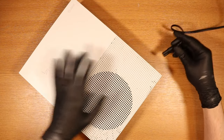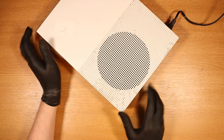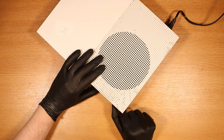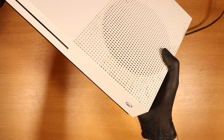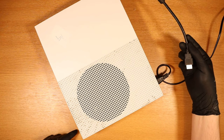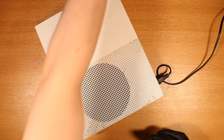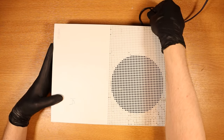I've just got my power supply — this is the three amp one so hopefully we're okay with that. Let's find out. We're just going to turn it on. I'll use the reflection on my glove to show you guys if it's working or not. It made a noise but there was no light. Okay, it's on now. The fan's spinning up. The light is on. The console is staying on. Apparently one of them was beep on beep off, and the other one just didn't turn on. Let me hook up an HDMI and see if it works on the screen. I literally went to put the HDMI in and the console turned off. I've just turned it back on and it turned off again. It stays on for about a good minute this one. Okay, so that's Xbox One S number one.